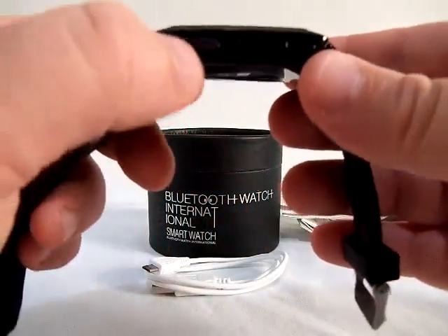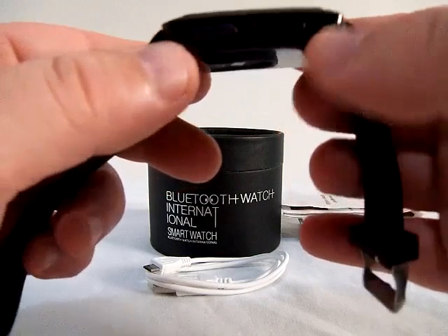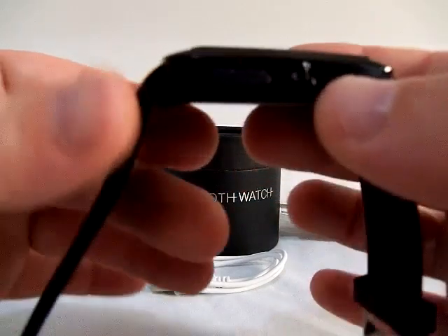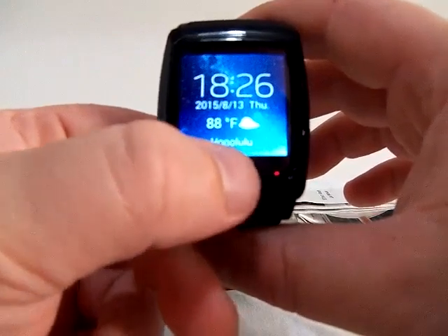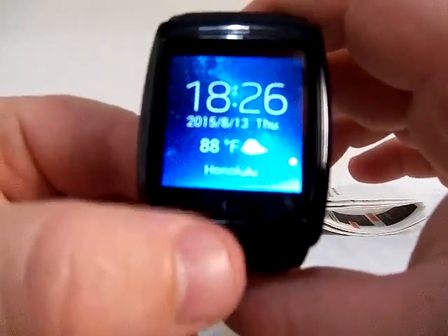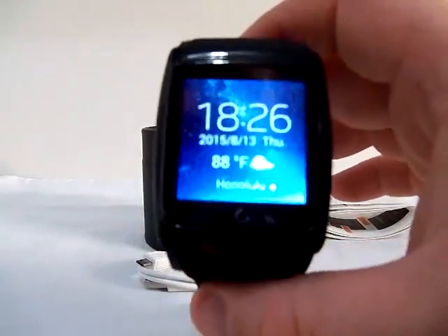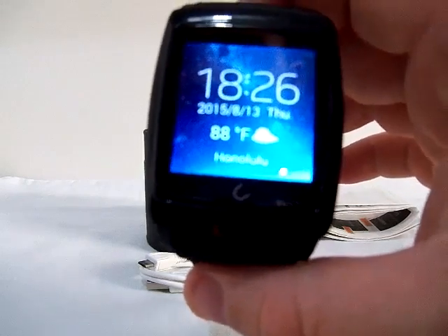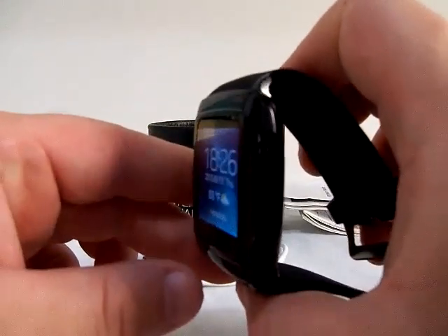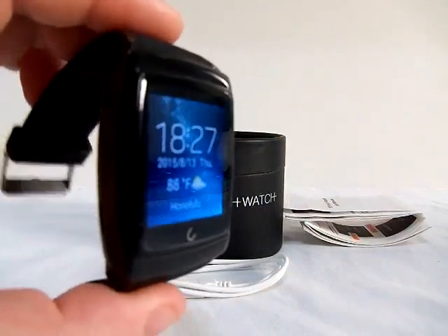On the right side you have your micro USB charging port covered behind a plastic cover, a microphone, and your power button. The screen below has a small U-shaped touch screen back button. The screen itself is made out of glass, and the inner display is a 1.54-inch capacitive HD IPS panel with a 240x240 resolution — it's really sharp and clear, and visible at wide angles.